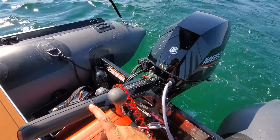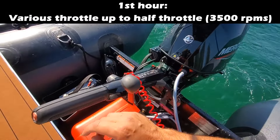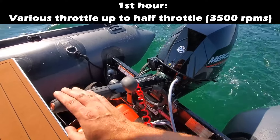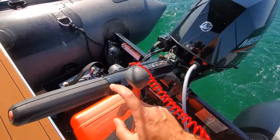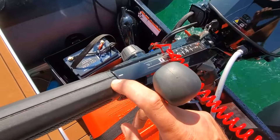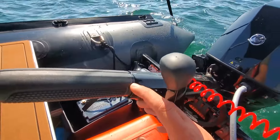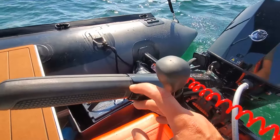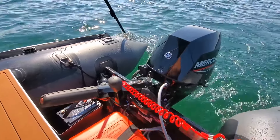For the first hour, we're going to be going from idle, varying speeds, up to half throttle, exceeding no more than 3,500 RPMs. Mine doesn't have a tachometer or an RPM meter, so you're just going to have to go off the gauge — this is neutral. On the side here, there's another little notch, so right in the middle would be half throttle. I would maybe take a little pen and mark it there so you know where half throttle is. That should be about 3,500 RPMs.